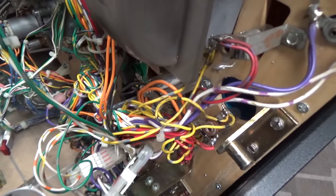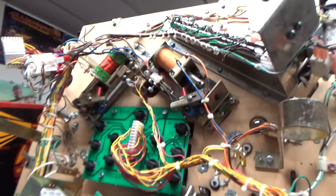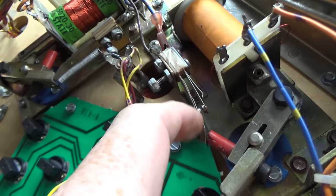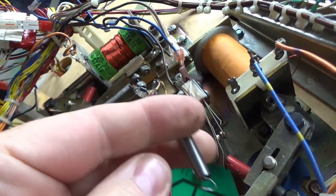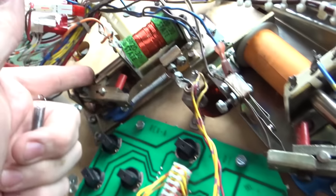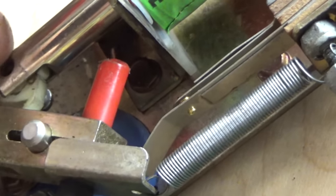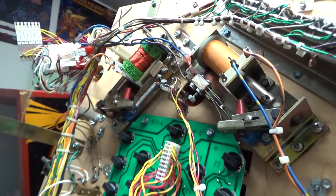I found a cut wire over here too — I don't know if I did that or if it was like that, but I put the wire back. The last thing we've got to mess with are the flippers. This one's sticking up, and when it pulls in it pushes out the end-of-stroke switch and then it stops — because this spring is missing, which was laying in the catch box. I saw this one stick once too, and I'm wondering if either one is because that blade is bent on that switch. Let me look it up and see if those are supposed to be straight or bent.